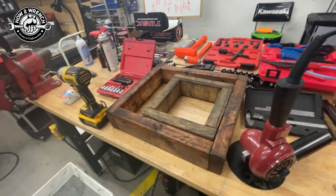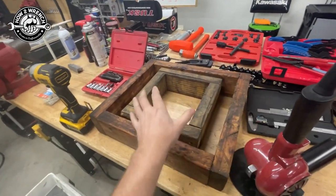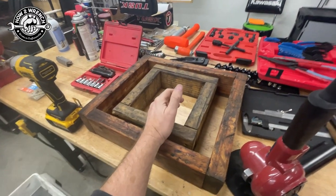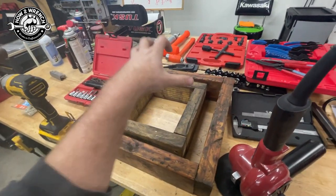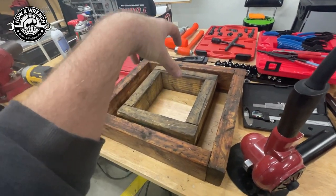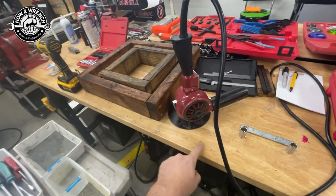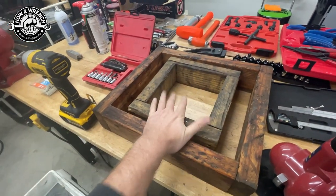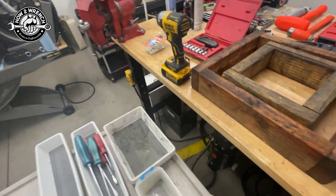For prep, I take some two-by-fours and make up a box. I'm grabbing a couple of my favorite go-to's — I can tell by how much oil and grime is on them. This gives you a nice place to set those aluminum cases on so you aren't hurting them, and you're not digging into your nice workbench top when you can do it on a sacrificial two-by-four.